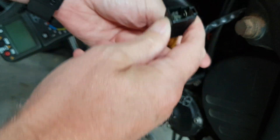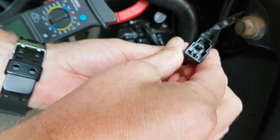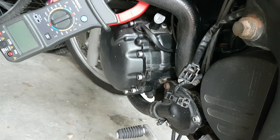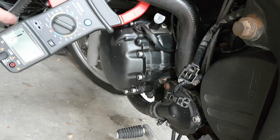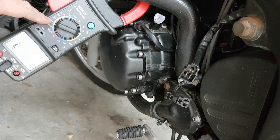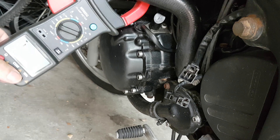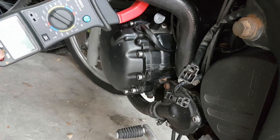This is leading to your rectifier — three yellow cables, three terminals. Grab your tester, right onto diode. It's like a little triangle on a line with a little cross going through it. Make sure you've got these cables in the right holes at the bottom if you've got a separate cable for the probes and what have you.